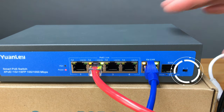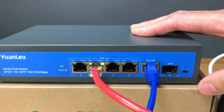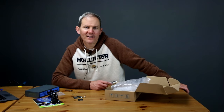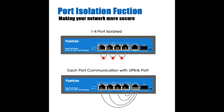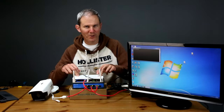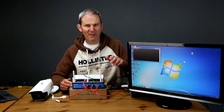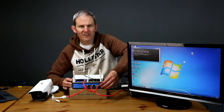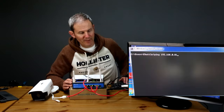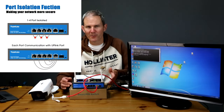Next, let's talk about this little button on the side labeled V and S. S is for standard mode where we have gigabit speeds on all ports — devices can communicate with each other and the maximum cable length per port is 100 meters or 328 feet on a standard CAT6 network cable. V is for VLAN or extended mode. When active, devices plugged into the four ports cannot communicate or see each other. For example, with my router plugged into the PoE switch via the Uplink port and a PC and PoE camera attached — in standard mode, the PC can ping and see the camera. When I activate extended mode and ping the camera again, I'm no longer able to see it on my network. Plugging my PC directly into the router, however, allows me to see the IP camera again, because VLAN mode simply prevents the four main ports on the PoE switch from communicating with each other.